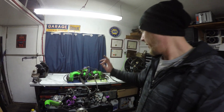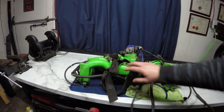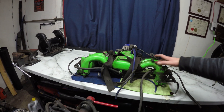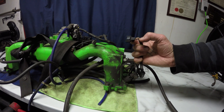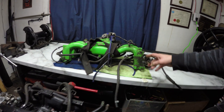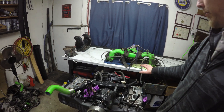I'm glad that I have at least the long block back together. I'm ready to move on to the intake manifold next — it doesn't need a lot of work, just a basic clean up. I am going to keep it the classic green that I've been using for probably ten years now. There's a hard line for the evap underneath that I want to eliminate. This connector for the cam position sensor has some open wiring, so I'm going to grab a new connector from another harness and go over everything to make sure it all looks decent.